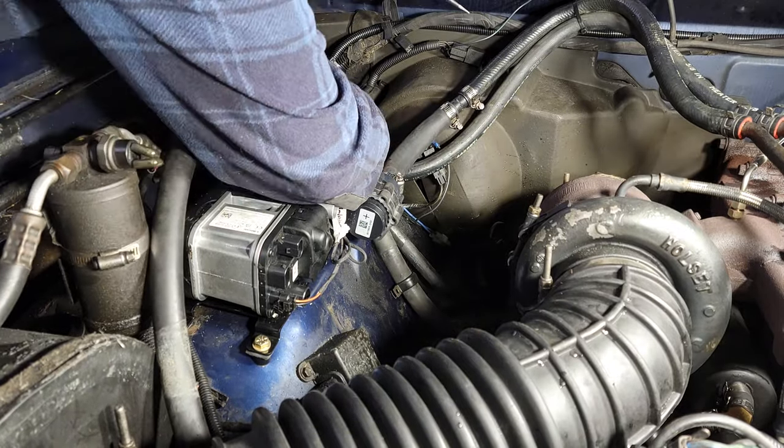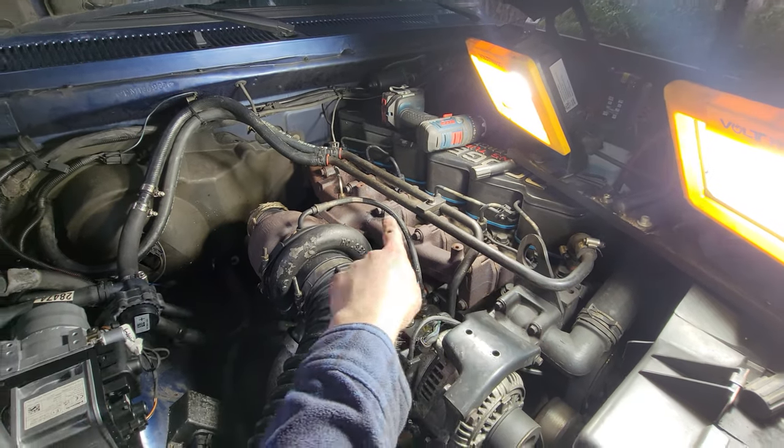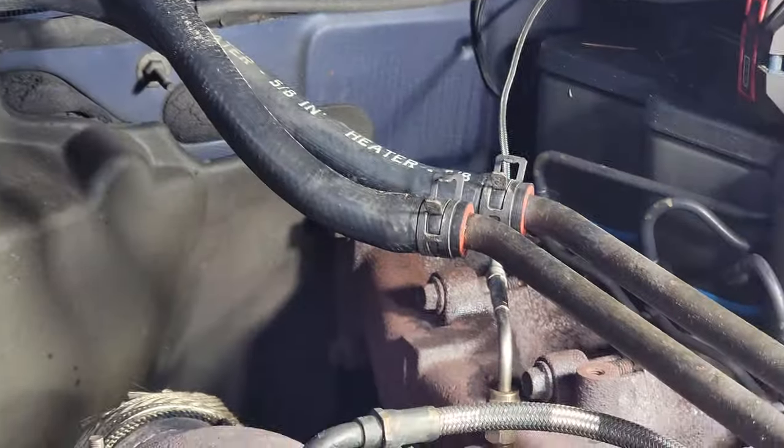I've got it all plumbed in now. Reviewing the plumbing: the feed line runs to the top, goes through the adapter into the three-quarter line, into the coolant pump on the Webasto, comes out on the inner side, through the five-eighths adapter, and then into the firewall where the heater core is. One thing to note: the installation manual recommends mounting the Webasto as low as possible because it's self-bleeding for air bubbles. Also, the way I've plumbed this is inline with the coolant, so when the Webasto is off I'm assuming coolant can still flow normally through it and through the heater core — so I can still use my heater core just running the engine.